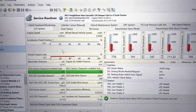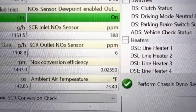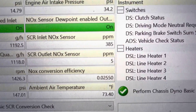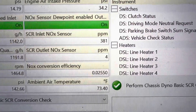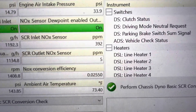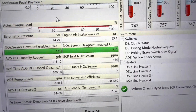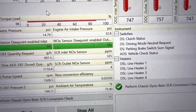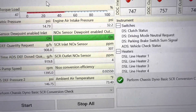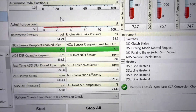After all that was done, I cleared my codes. Here are my readings for inlet and outlet NOx. They're supposed to be 450 parts per million — that's what PPM stands for, parts per million. Code is cleared. Let my regen run after I changed my sensors — it's always good to do so. At least run a regen and let it go through the whole system and everything like that.